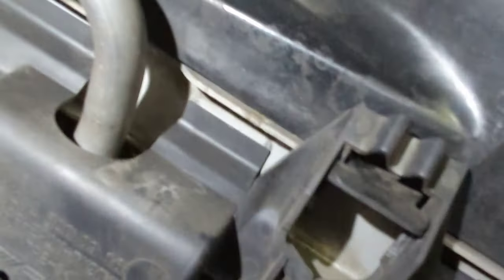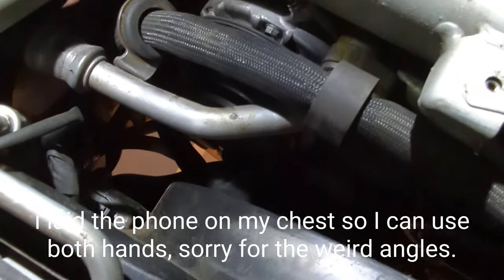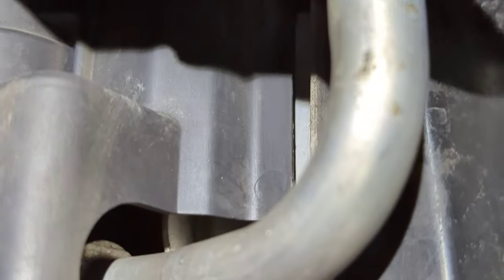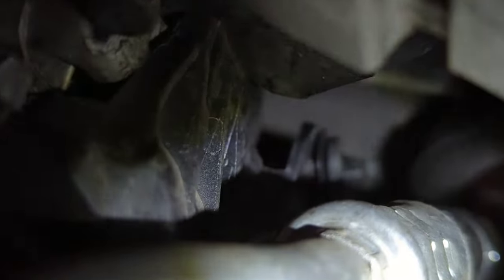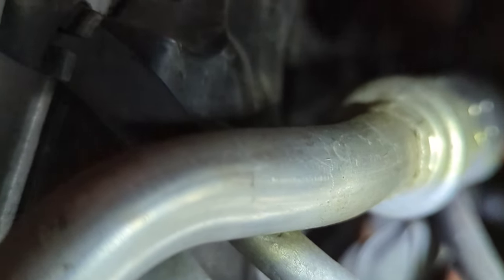When pulling the fan out, there are these weird-looking clips that you just have to spread out and get around that little tab — there's one on the other side too. That's how you get the bottom tabs out for the fan. Then you just have to do the two top ones and you can pull it right out. There's also the wire harness for the fan right here. There are two little plastic screws that go inside small holes — they're not screwed in, they're pressed in, so you have to pull them out with a flathead screwdriver. Pull those right out and then you can slide the fan up.